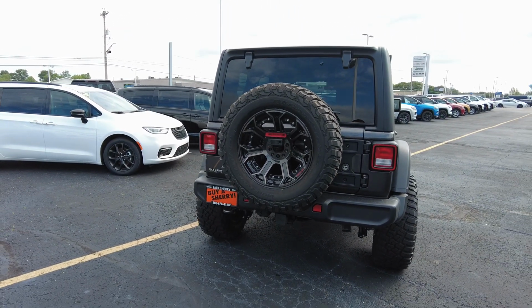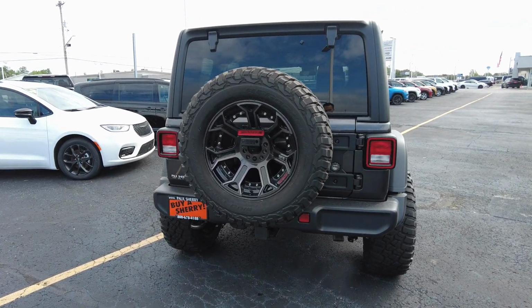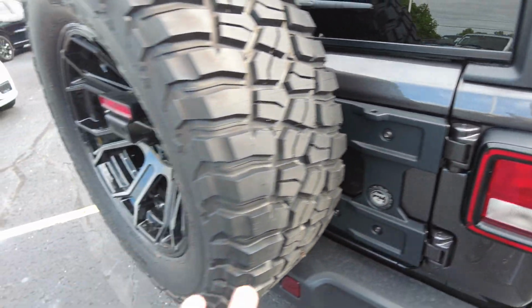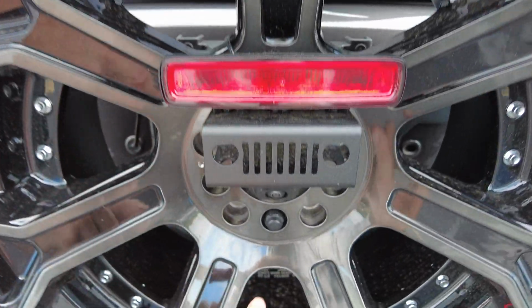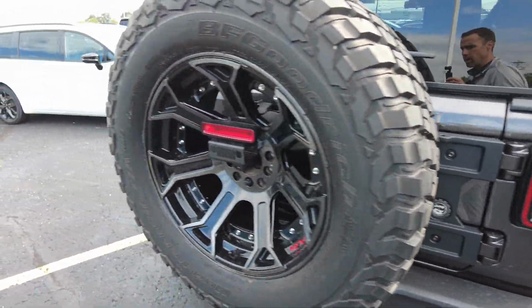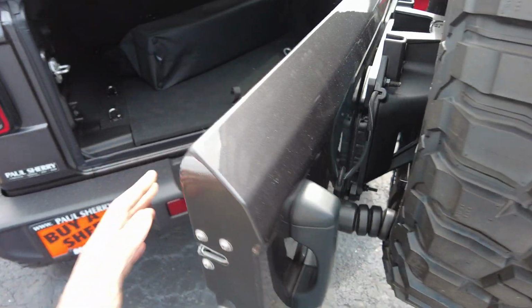Spare tire and wheel is the same size as the rest of them. A lot of converters don't do that. They leave the factory wheel on there or just take the wheel off altogether. The reason for that is the factory wheel mount, which is also the door hinge, doesn't jive with this bigger wheel and tire. So there's actually some engineering that needs to happen. SCA does that. They relocate the third brake light, still integrate the backup camera, and upgrade the hinge and spare tire assembly.